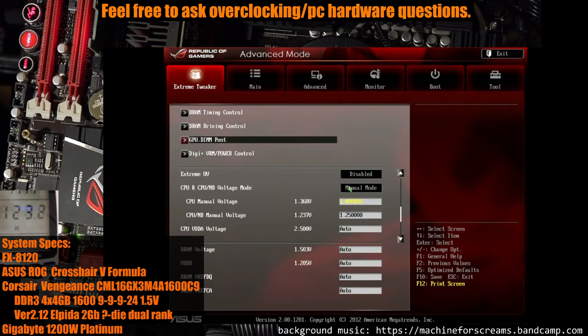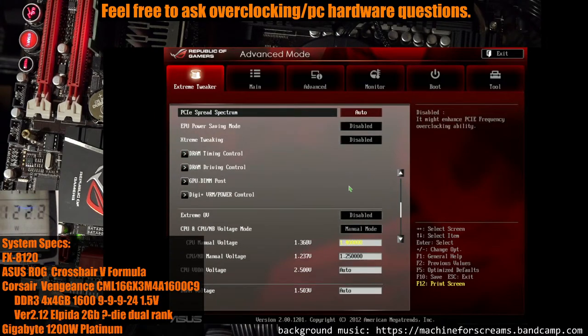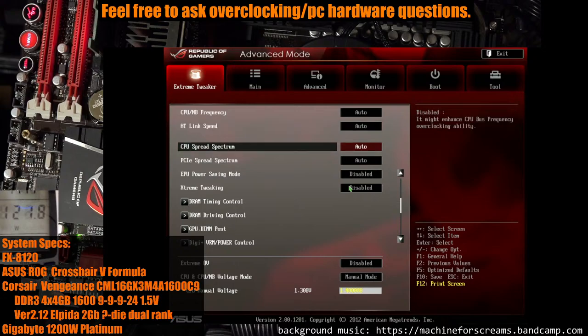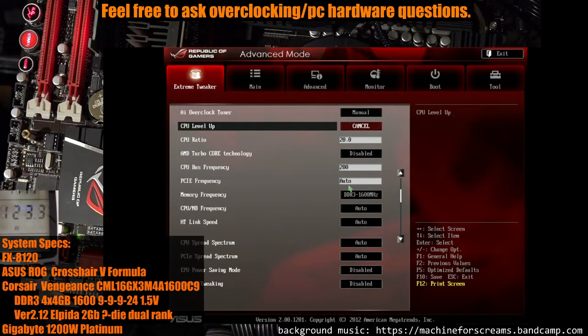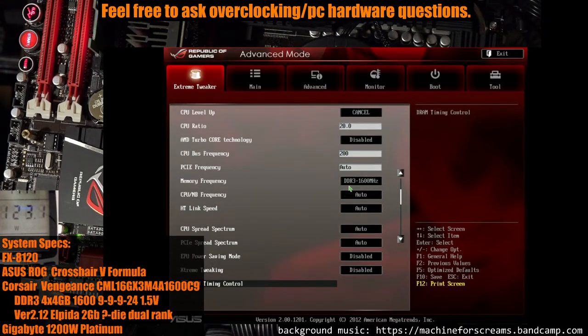That's the really funny thing on a lot of modern motherboards. Some of them still offer a VRM switching frequency setting, and basically it does nothing. On a lot of modern motherboards, you can go all the way up to 1 megahertz switching frequency, and it does absolutely nothing. On some motherboards, it actually causes issues rather than helping anything. Funnily enough, I think on Gigabyte Z390 boards, you got the best voltage regulation at 300 kilohertz, or maybe slightly below that if you used an external tool to get direct control over the VRM.